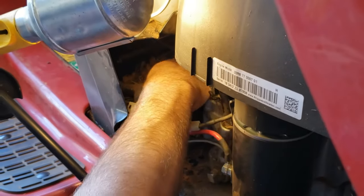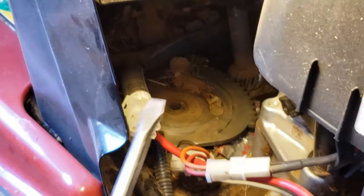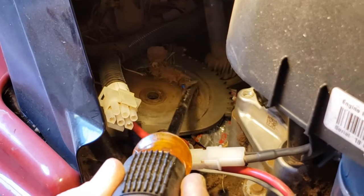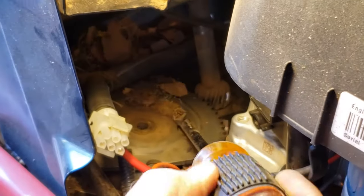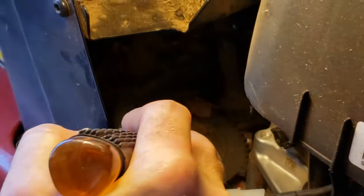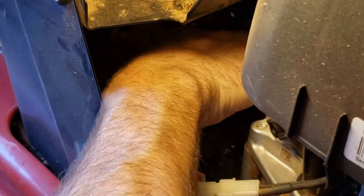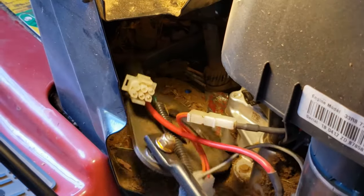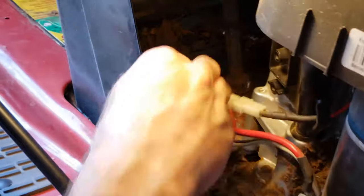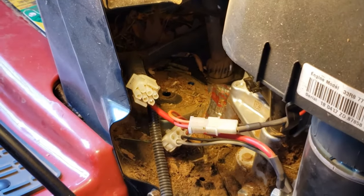Now this whole plate setup can be taken out. And if you'll see, there's this groove here — and the reason it wasn't turning is because that groove is full of dirt. See that dirt there? As I would turn, that bolt that was there, this would turn and then the dirt would get compressed and it would get stopped. So basically you've got to clean this whole area out — get all the dirt out of the groove. Here's this washer, this spacer — keep that, don't lose that. All of this dirt and debris needs to come out of here, because that's the problem.